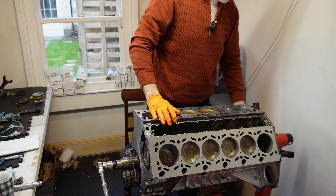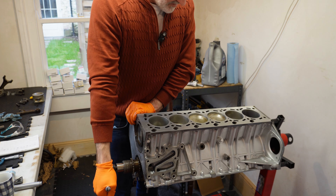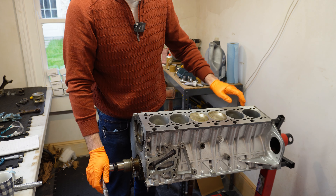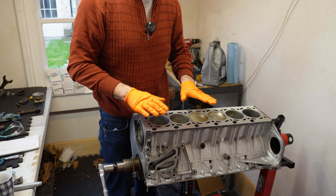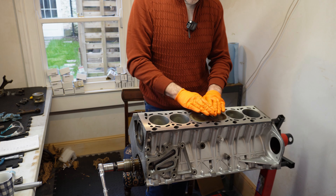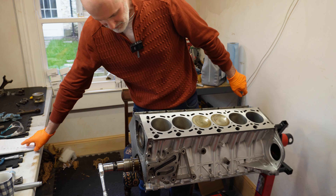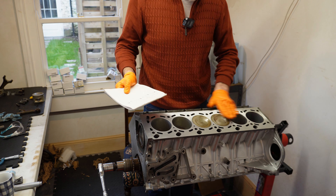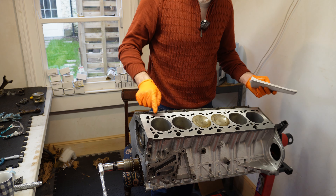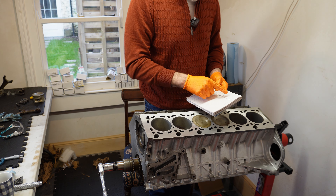The issue I've run into is piston protrusion - that's the amount of protrusion present when your pistons are at top dead centre. This engine is designed to have a level of protrusion; some engines the pistons don't protrude at all, but on the M70 they do. Both banks were decked - skimmed. I've measured piston protrusion across bank 2, cylinders 7 through 12, and they're all perfectly uniform. The level of chamfer is the same on every single cylinder top, and the level of protrusion is around 0.8 of a millimetre.